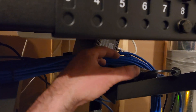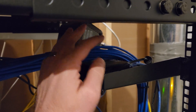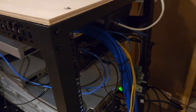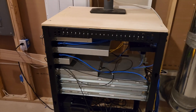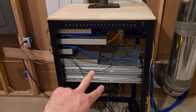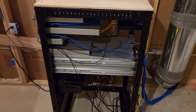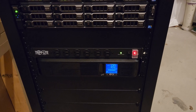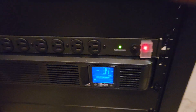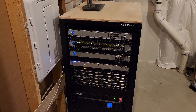The full view — we've got the top back on and this looks really good, huge improvement. Around back on that shelf, I've got the Raspberry Pi hooked up to the UPS with a USB cable, listening for power outage events. When the UPS goes into battery mode, this guy can tell servers I've configured to shut themselves down. The two Dell servers are now on the UPS. During peak power draw while the servers were booting, the UPS was telling me I had about 19 run minutes, which is pretty good. I definitely need to get another UPS for everything else.